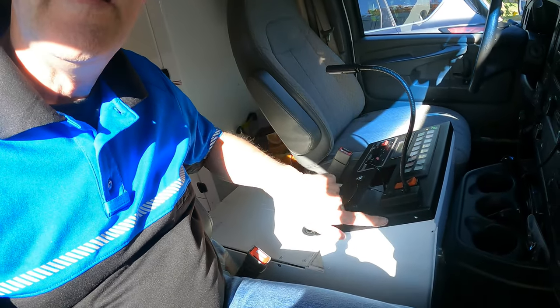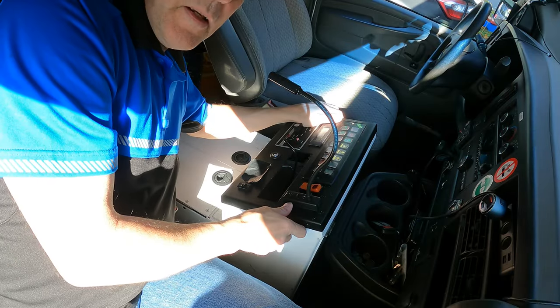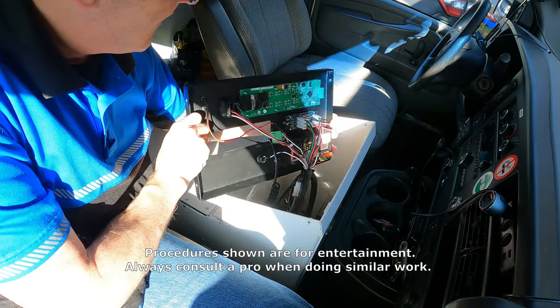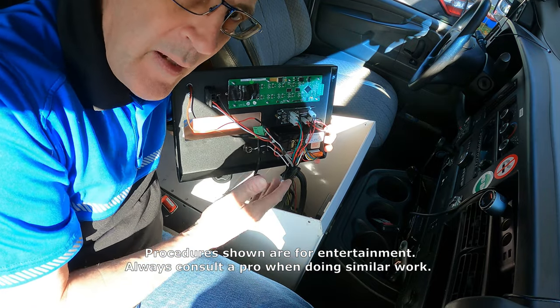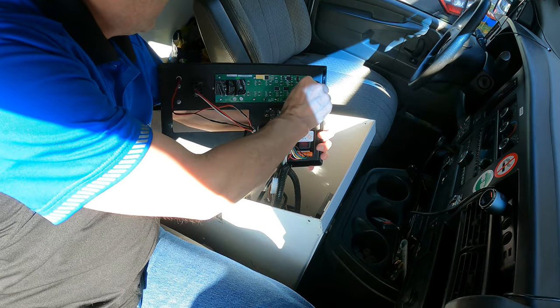So what we found is when the tech guys for the ambulance service removed the radio at the console for the driver, they also left the screws out of the sides of the cover, the top of that mount for the console. So we were able to lift that up very easily. In fact, let me show you. Okay, so it's these screws right here that were left out. So we're able to force this up like that, with a little bit of force. To make this buzzer alarm shut up, I found we could disconnect this connector from up here, and that made everything quiet.